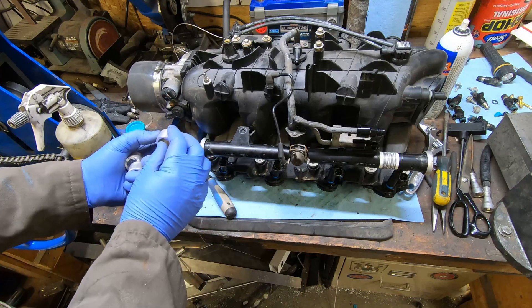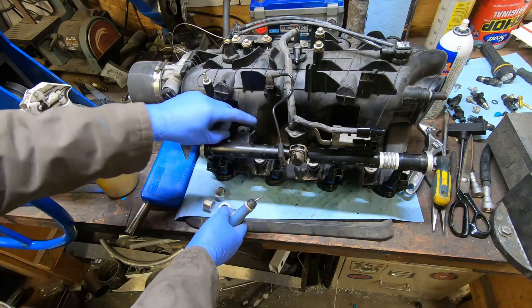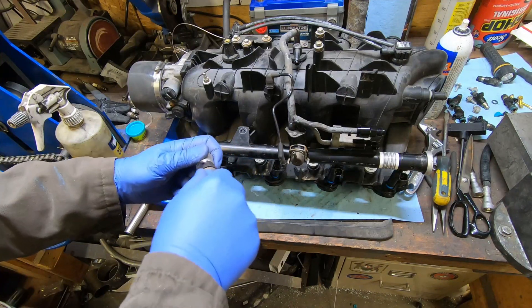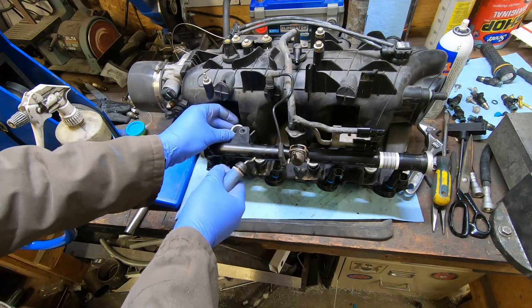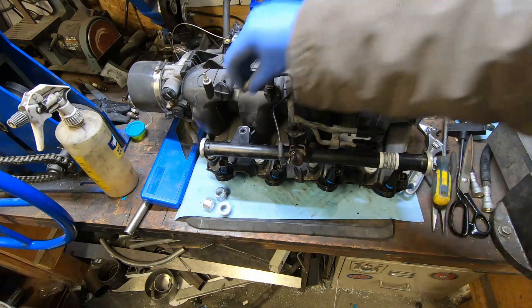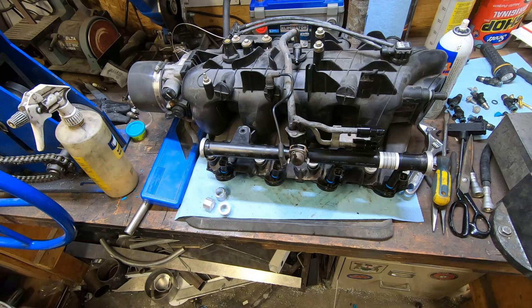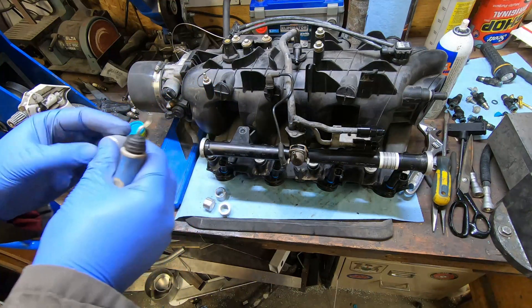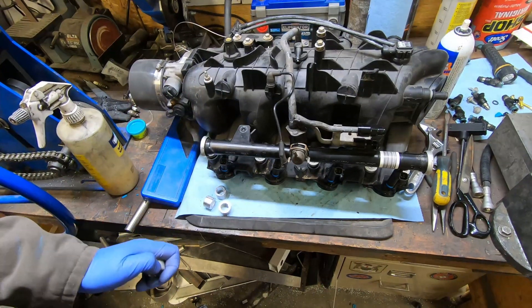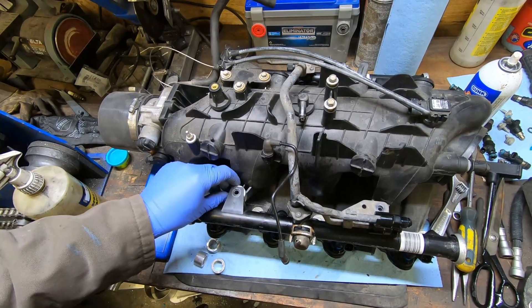Because the fuel rails are now higher, I cut four spacers and they'll just fit under there. The one problem is the factory metric bolts are too short — they're about an inch too short. I'll look to see if I have any extra metric bolts in the right length, but probably not. So what I'll do is drill out the brass fitting in there and re-tap it — I have lots of SAE bolts so I'll probably just put a quarter-inch bolt in there.